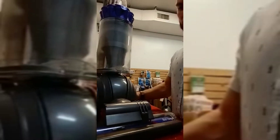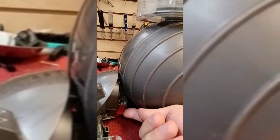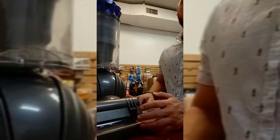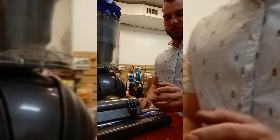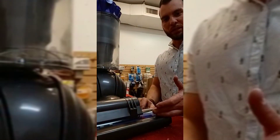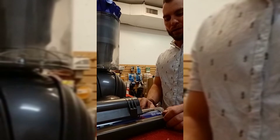One last thing before you go — on here you'll notice this brush roll. These are really easy to pop off and clean. There's a little red clip right here that will pop off and release the whole power head. Then there are two little side clips on each side — you pop this off. You should be cleaning that roller. Don't let it build up with a lot of stuff because it's going to lose the quality of dirt it's able to pick up. You want this to stay relatively clean so there's good airflow and nothing's trapping the roller up.